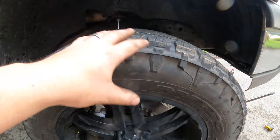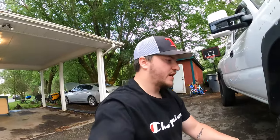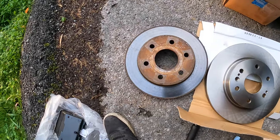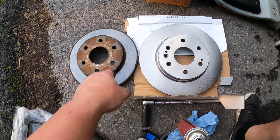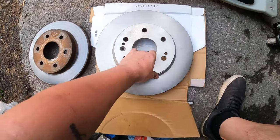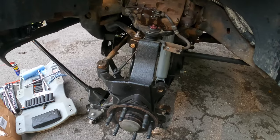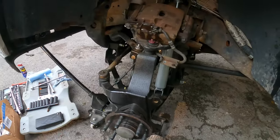If you're uncomfortable with how close that is, you can always shave off this slot, or you can always put a little spacer in there. This side's done so I'm gonna run over and do the other side real quick off camera. I'll probably show you guys how to put these brake pads in — super simple, takes a couple seconds — then bleed the brakes and that'll wrap up the video. Also just for a size comparison on the rotors: that's the old one, this is the new one — a 13.5-inch rotor compared to what I don't know, maybe like a 9-inch rotor. That's a pretty good upgrade and they're heavy.